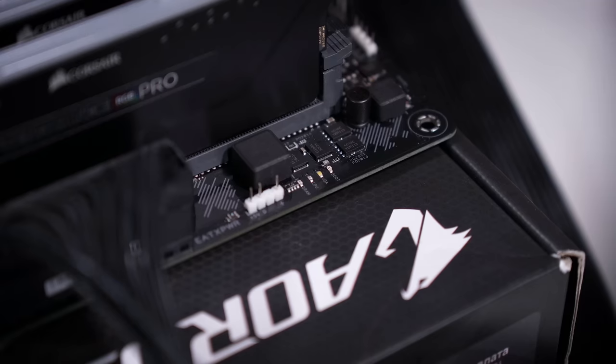There's not much more we can do beyond update the BIOS — there's nothing really at a hardware level I can do with these boards unless it's very obvious. But that's fantastic. This is a post. You can see our BIOS version is 4403 — that checks out. Everything seems to be running just fine here. Now I'm trying the innermost two slots, which I know is a bit unorthodox — you're not really supposed to do this. But look at that — we've got a boot. That's good news. And now let's try the outermost two DIMM slots. Would you look at that — still works. You can see slots A1 and A2 there, which are the two outermost DIMMs. It's actually B to A ordering, which is a bit strange, but it works now and that's fantastic.